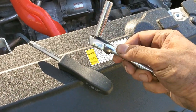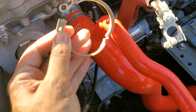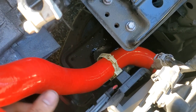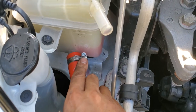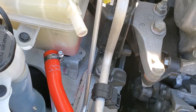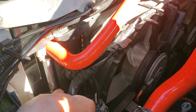Using a small socket wrench with a 9/32 socket, along with a handle that also fits the smaller sockets, will make tightening down the clamps a lot easier. Two down. The clip that held the O2 sensor wire in place is going to be too big now, so I'm going to go ahead and just remove it. The other clip will still function to hold the hose in place. Three down, two to go. When you tighten down these clamps, don't over-tighten them — tighten them down until they don't want to turn anymore, then just give them a little bit more of a turn and leave them there. You don't want to tighten it too much because it is only plastic underneath most of these hose connections. Four down, and that makes five. I aimed the worm screw clamp on this side down so that I can just take a socket on here to tighten it.